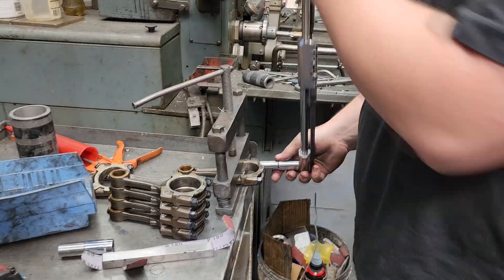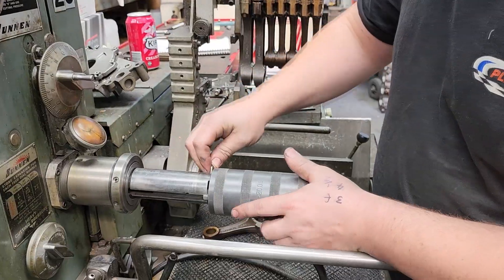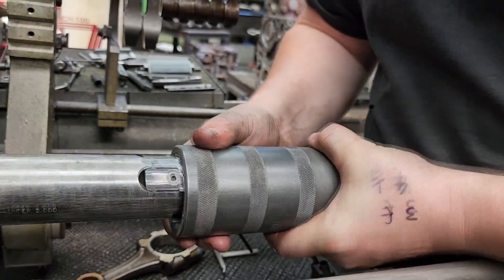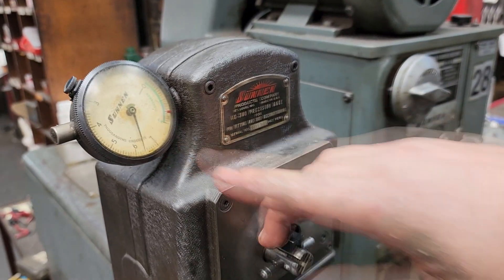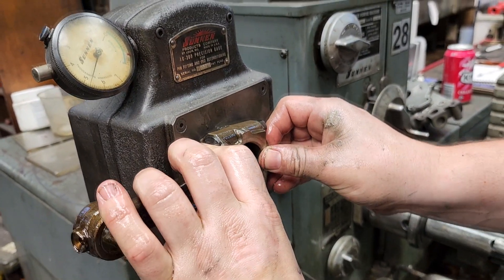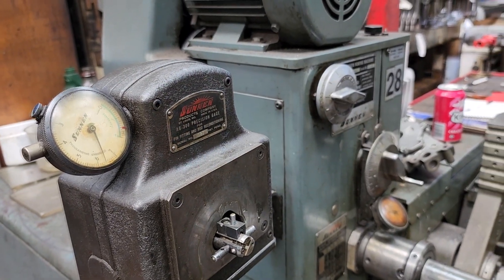So you're fully doing them up to torque? Yep. We're setting the arc on the guide's truing sleeves to make sure the stone's nice and flat for resizing your rods. There's a stone that goes in and out on this side, and these two guides here pivot so you get the shape right. Each number on this gauge is one thousandths of an inch, and each smaller division is one ten-thousandths of an inch. So I've got five thousandths to hone out of this rod to get it to the bottom spec size. I've set zero at the bottom spec size.